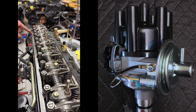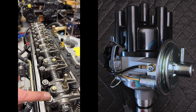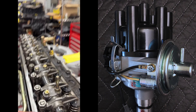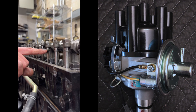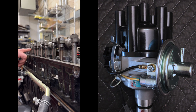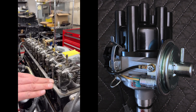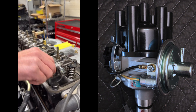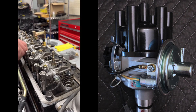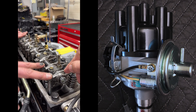You can see like 10, 11, 12 — this one right here, they're open. If you look at the push rods from an angle, these should all — one, two, three, five, seven, and nine — be at basically the same height. Toyota cam, the base circles are off just a little bit, but they're all going to be even. So I just go: yep, it feels loose, loose, loose, loose. I'm good. Top dead center compression — I don't even go past number three.